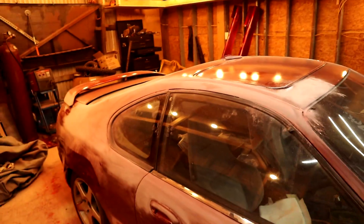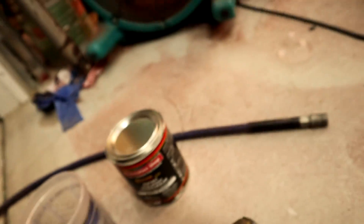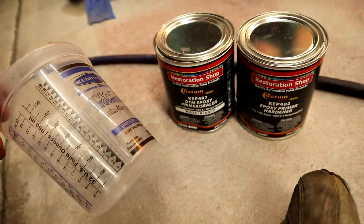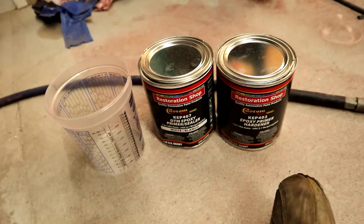Every area that's sanded is where it reacted. The whole hood is messed up, but where it's not sanded it didn't react — all of that bottom piece, all of that door, the quarter panel, the whole bumper and lip. I don't even want to repaint — that's all cleared and nothing happened to the bumper at all. I got my mixing cup and some epoxy primer — this stuff mixes one-to-one, primer sealer, hardener. I'm going to mix just a little bit to do the side skirts, just one coat.